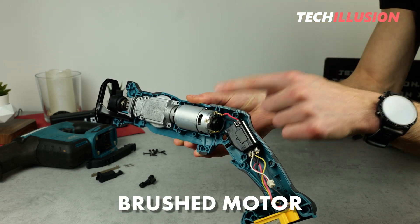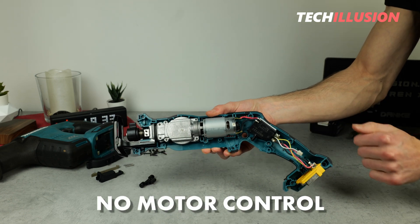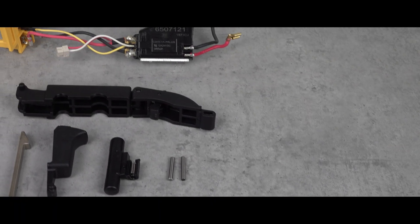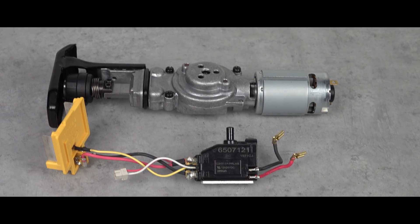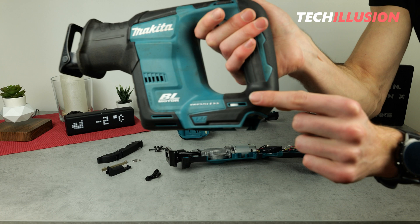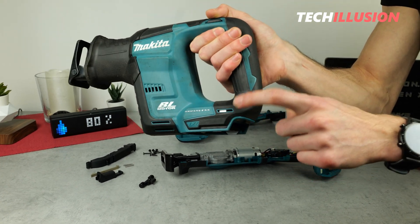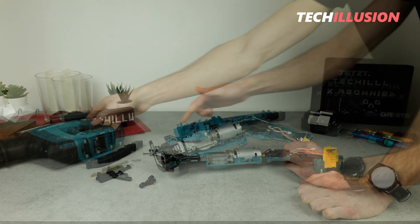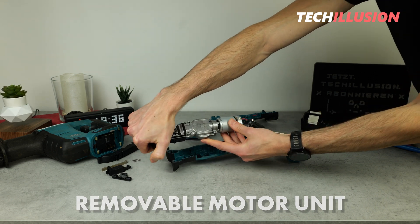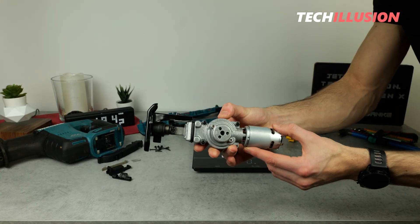This means a regular brushed motor is installed here, as there is no motor control unit — essential for a brushless motor like in the Makita DJR 188, as evident with the BL motor designation, which definitely requires a motor control unit. That unit sits at the bottom of the machine, also visible with a small aluminum heat sink under a recess. There's no need for a motor control unit in this one, so we have a regular brushed motor. The entire unit can, of course, be completely removed from the housing, with the motor only connected to the switch by two small plugs. Now in hand — the heart of the small reciprocating saw.